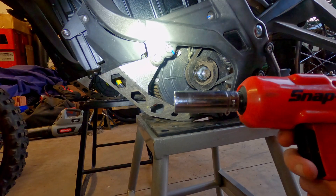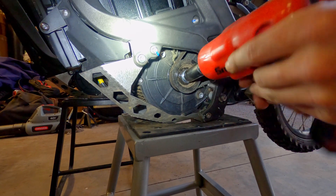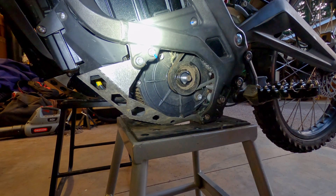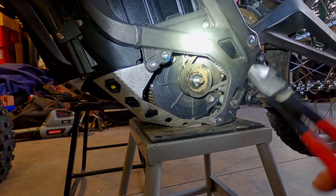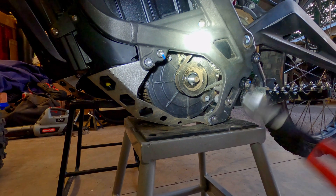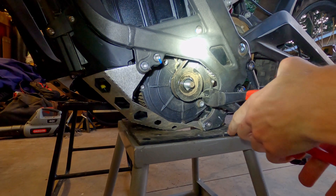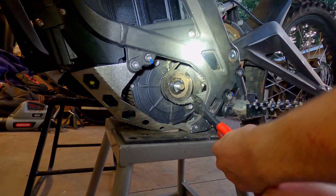Sounds like I stripped it. The first step for the chain conversion is to undo the pulley nut. I decided to use an impact and keep the rear tire on so I could make sure that shaft doesn't turn — if you use a ratchet wrench and take the wheel off you might have problems with it spinning around on you. Since my belt was completely stripped I decided to just cut it off with pliers. I would recommend doing this as there's really no reason to save a ruined belt. If you wanted to save the belt you would just want to wait until you remove the hub and slip it off over the side.